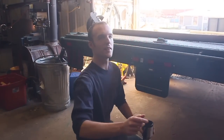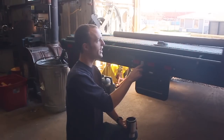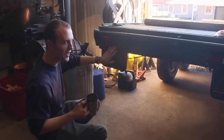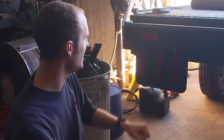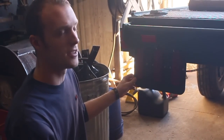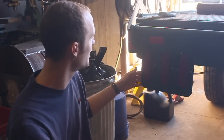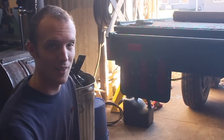We're going to replace this cheap light bar with three push-through LEDs — they're much higher quality. The tail lights and turn signals have the same problem: flimsy plates that aren't very strong and are vulnerable. So we're going to take a piece of two-by-six square tube — 14-gauge, thin wall — run it under here, and reposition all the lights so it looks and works quite a bit better.